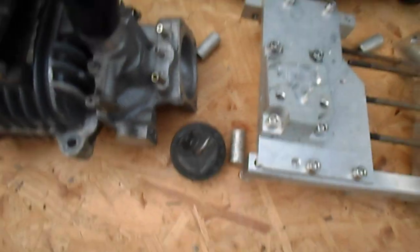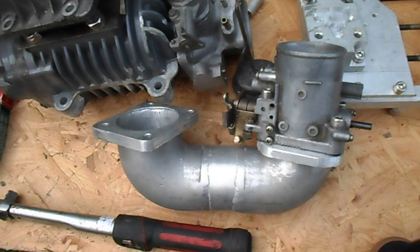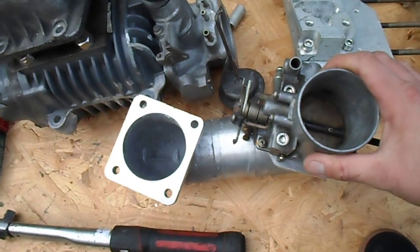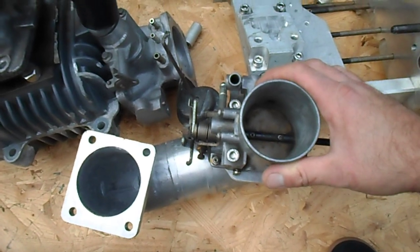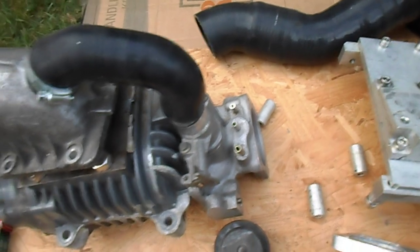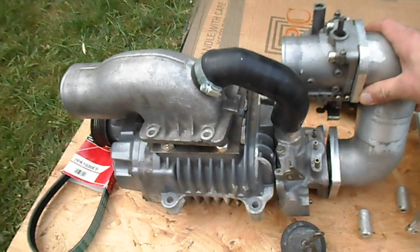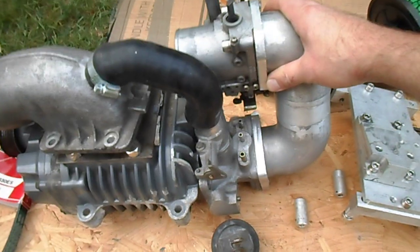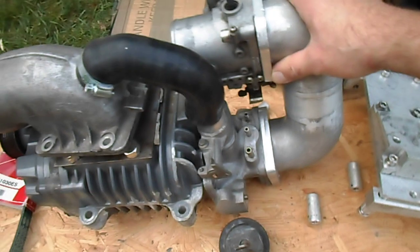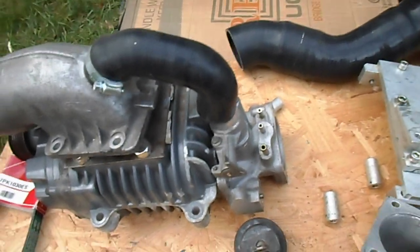A couple of guys at work who are good welders helped me make a new throttle butterfly intake out of three mil aluminium. It's a bit thick but just about clears the engine mount on the engine side, and there's a chassis rail there so it is close - but it bolts on like so. It does make it quite a long supercharger when it's all up there, but if I was using a long snout it would be way too far back. M62s are quite short as well, but I wanted to go M90 because it's quite a big engine.